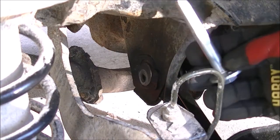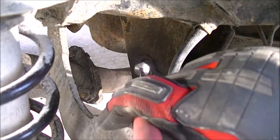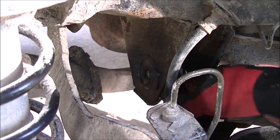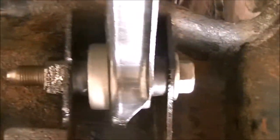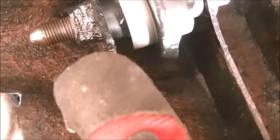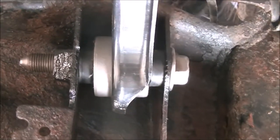So this is the bolt. As you can see, it's slotted — I'm using a magnet to retrieve it. There's the cam; that's what holds this top portion in place. On this side we've got this bolt and welded nut right here. As you can see, I was air chiseling it — that's what holds this top portion in place and it needs to be removed. Be careful because that nut on this side is welded, so removing it could be very difficult.